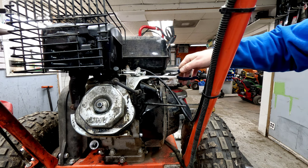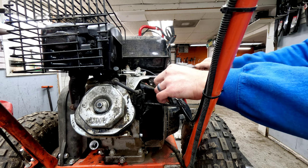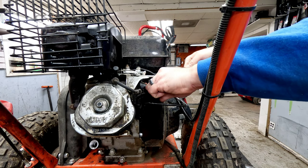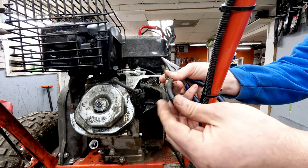this may be an issue with the fuel line even. We're going to take this fuel line off of here. We're going to replace it while we're right here also, just to make sure that that black is not being contributed to by the fuel line. Now, we know that's not the case in the tank because from the fuel line, it wouldn't get in the tank, but all we're going to do is replace this line.